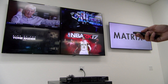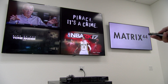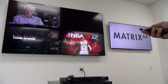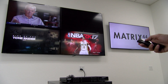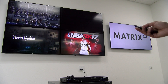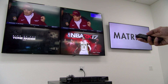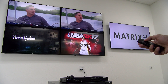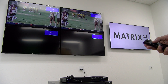Let's take our remote control for a test drive. Right now we have all TVs showing separate HD sources. Say we want the top right display to show the cable box — that one is output B. So we'll select output B, input 1 for our cable box, and hit go. Now we have both screens showing the cable box. If we want all of our TV sets to show the cable box, all we have to do is hit all, input 1, go. Now all our TVs will show the cable box.